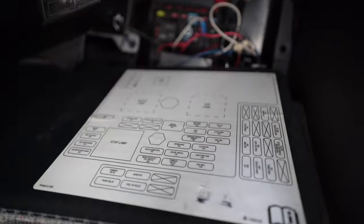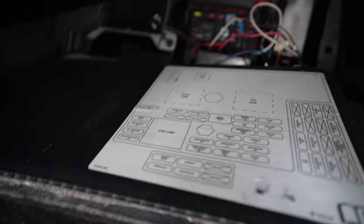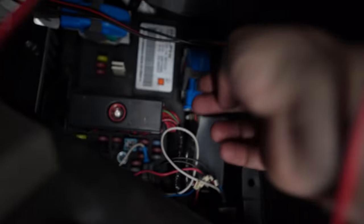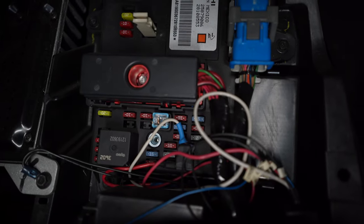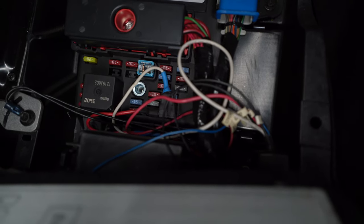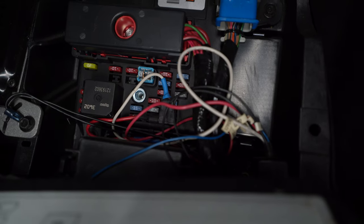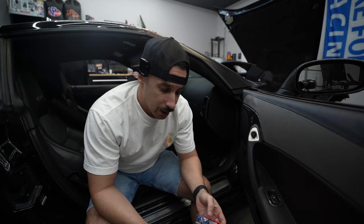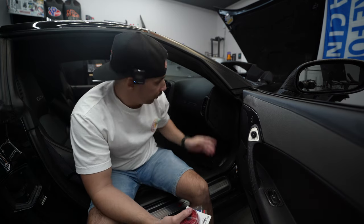Right beneath the passenger footwell, you can just pull and slide this little panel down. You can see the seat warmers — it's a 10-amp fuse right here. The camera's focusing all over the place but it's that 10-amp at the very top. You can actually see someone already had one spliced in this manner with another one of these fuse taps. I'll make sure I don't interrupt that one because I do need to wire mine in. Then I'm thinking I'll just ground it right there on that screw right there.